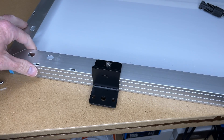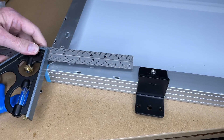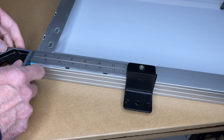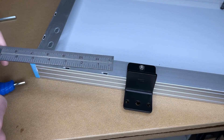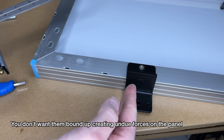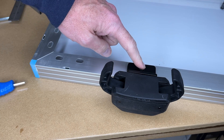When I mount to the other side, I want to have the exact same distance from the edge, and something like a carpenter's square is a good tool to measure that. I'll butt it up against the side — I'm just shy of seven inches there — I'll tighten that down, and then I'll place the bracket on the other side in line so they're straight when they're on your cross rails. So on the car, this will clamp down on the rail. I'm going to get the four brackets mounted and head out to my Land Cruiser.